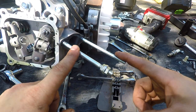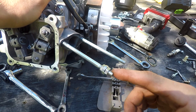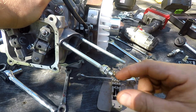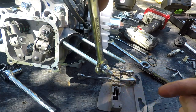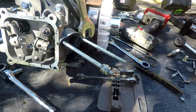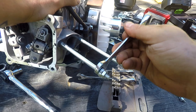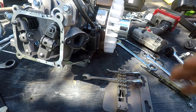The next plan is we're actually going to be removing these carb studs - we're not going to be using the factory carb on this engine, on either one of them actually. What you do is take the nuts that originally came on the carb studs, put one backwards on here, then another one the regular way, and tighten them together real good. Then take a 10 millimeter wrench, put it against the back one, and if you've got it tightened up enough the carb stud will actually start backing out. I'm going to take both of these out.